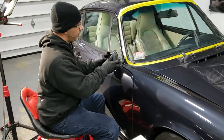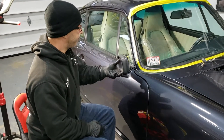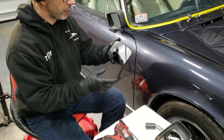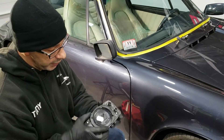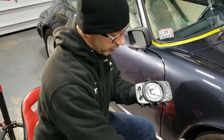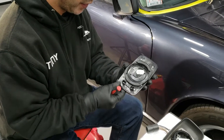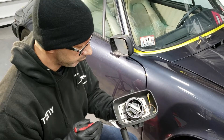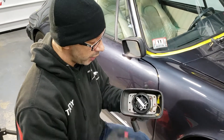This is the original mirror that we have here from the '87 — it's not the Aero model. So we're going to get started on taking this off. The mirror glass itself is held into the mirror housing by a locking ring right here. As you can see, this will rotate to lock and unlock it. We have these four little slots with nipples on it, and that is what connects or engages the back end of the mirror. When we lock the ring, we lock these pins in place and the mirror stays in there.